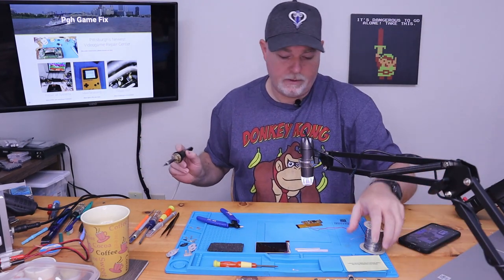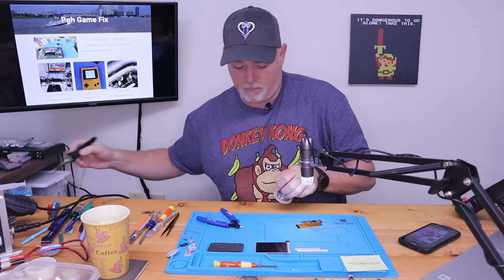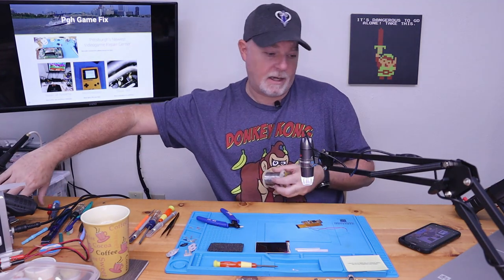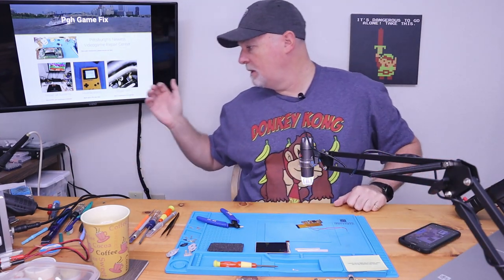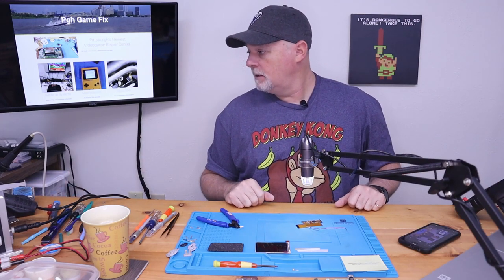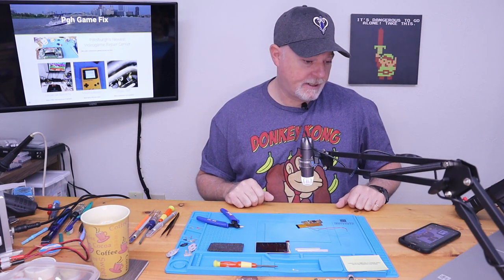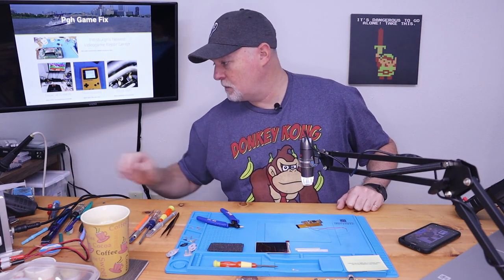One of the things you can do to help keep your soldering tip clean: you shouldn't wipe it and then put it away, because then that's just going to build a layer of oxidation. Rather, what you should do is coat it up, stick it back on the stand, and turn it off. The actual soldering iron I use here at the shop I've had probably 25 plus years — it came from my grandfather's television repair shop and it's probably 30 or 35 years old, but it's a real trooper.